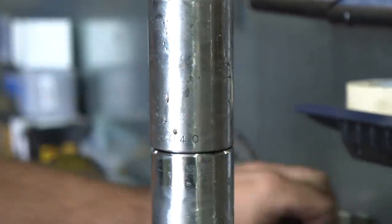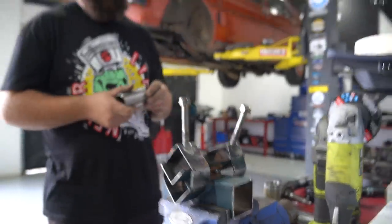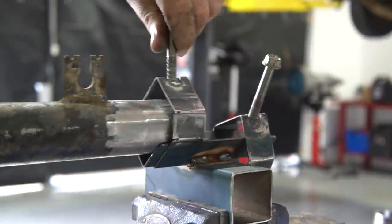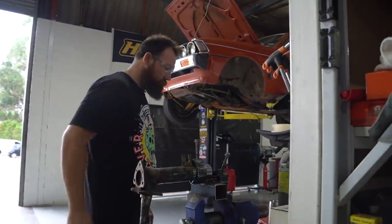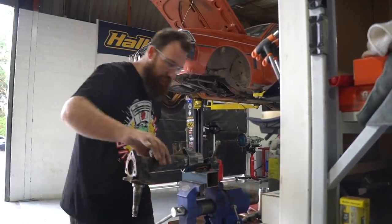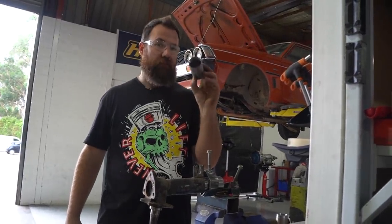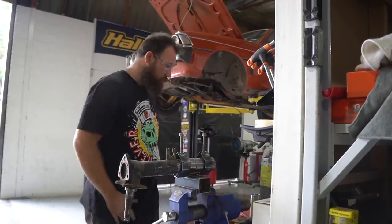So now that's all looking pretty good. This is a little jig that I've made up so that we can bolt both halves of the strut into the jig, to basically lock it all together and keep it square. This is made out of fairly light gauge steel — good enough for what we're going to do, but if you're going to be cutting struts down every other day you'd want heavier gauge steel. Once it's bolted in there it'll be pretty well good to go. Obviously make sure you pay mega attention when you're putting this in because if you happen to weld this in backwards and put the thread towards the body you're buggered. I haven't done it because I've never actually cut struts down before, but if someone's going to do it it's going to be me, so watch this space.